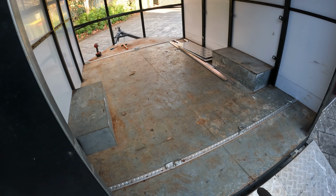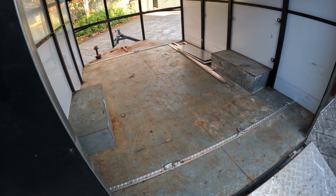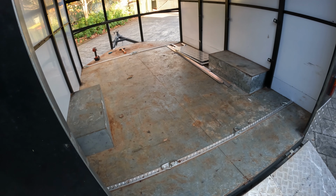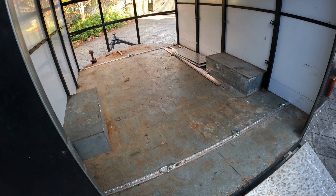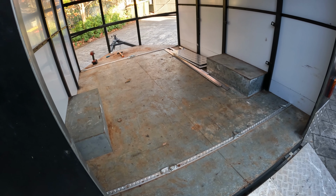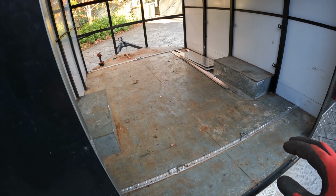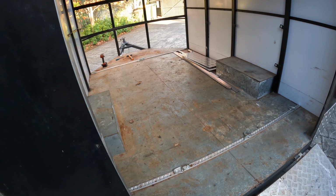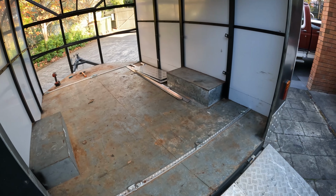This gets a little bit slippery. It's just a gal sheet, not very thick. I think it's like 0.4 or 0.5 thick, just riveted to the frame, so that can come out easily. And then I think I'll sheet the floor with checker plate, and then I would like to put some sort of sweep or washout grill in the middle. I don't really know how I'm going to do that yet, but I just find that it'll be nice to be able to sweep everything out or even hose this out, and then also checker plate the wheel arches there,